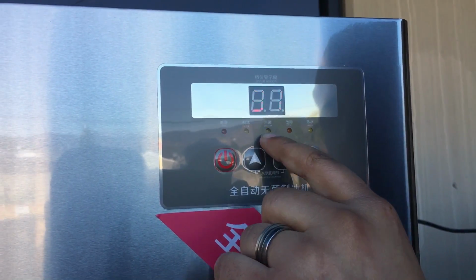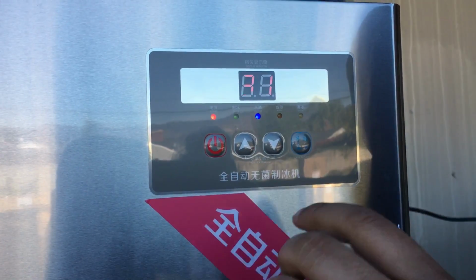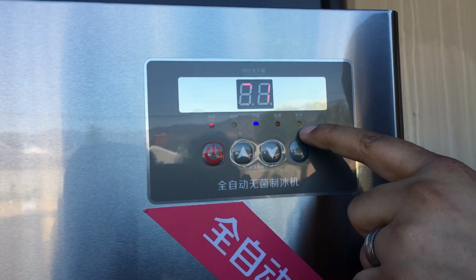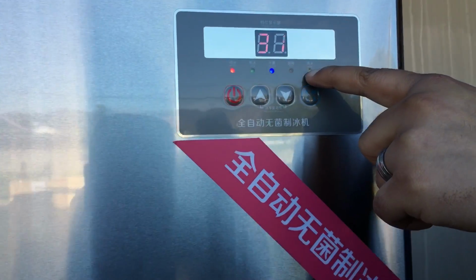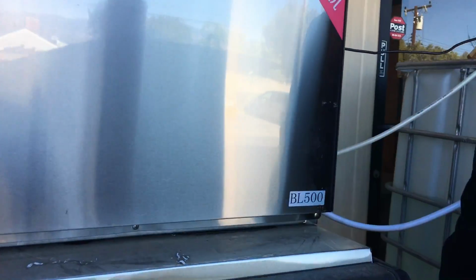This is a sterilizer when it's on, so it's sterilizing the water. If an error signal goes out, it's on here. The light will be blinking or solid. And when this goes on, it's a yellow LED light. That means it says on here dice. That means it'll start dropping the ice to the bottom of the bin.